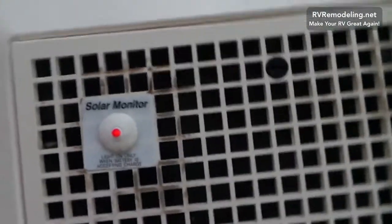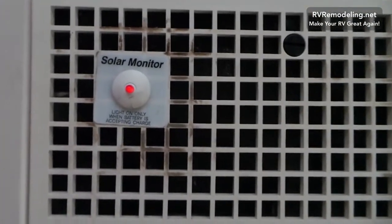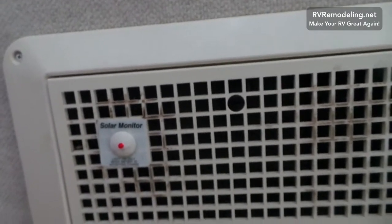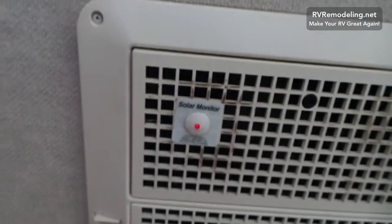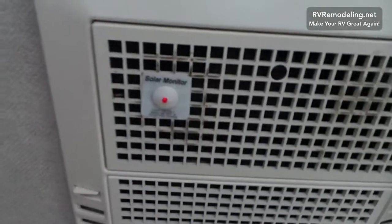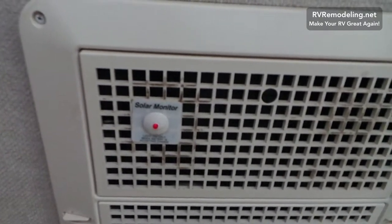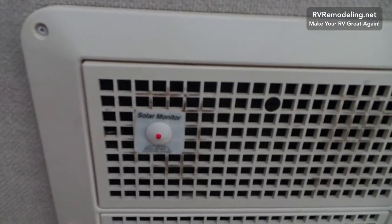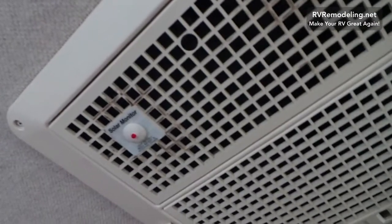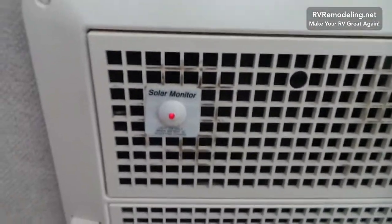Now if you want serious solar power, you need a lot more watts, a lot more space, separate wiring, a separate inverter, charge controller, and probably more batteries altogether. We'll get to that in the future — I'm actually going to do solar in the rear part of this coach, there is a lot of open space. But this is how you get your trickle charge solar panel going — just replace the old one. This is a Fleetwood Southwind, but there are many manufacturers around 2000 or so that were doing this, so if you have that trickle charge solar panel and it's not working, chances are it's broken because most of them break.